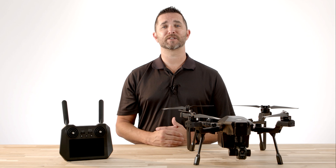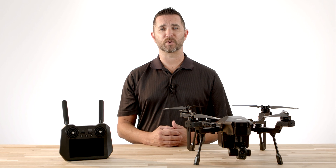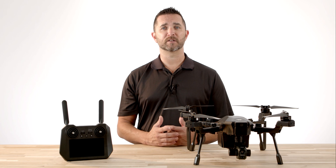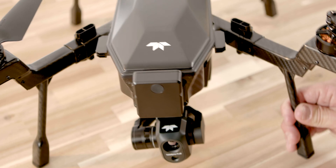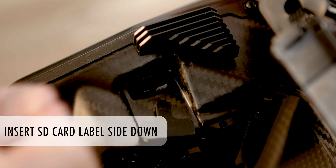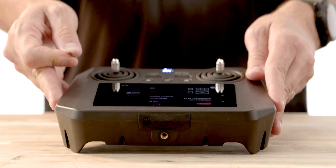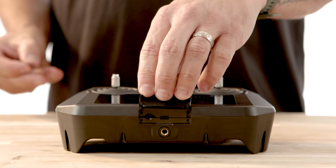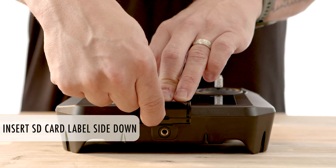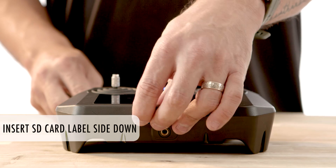There are two micro SD cards for this drone: one for the aircraft and one for the controller. The one on the aircraft can be a bit tricky to find and install. You may want to grab a plastic tool such as tweezers or a plastic pin to help install it and get it back out. On this drone, you'll see a protective cover on the front of the aircraft. Open the cover and carefully insert the micro SD card until you feel it click — at that point you will know it's fully seated. The SD card for the controller is used for firmware updates and to preload your maps. Hold back the protective cover on the bottom and insert the micro SD card until you feel it click, then close the protective cover.